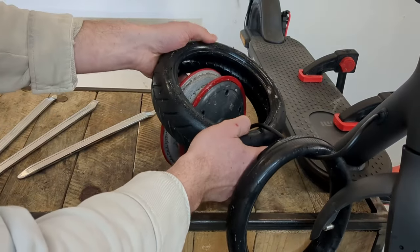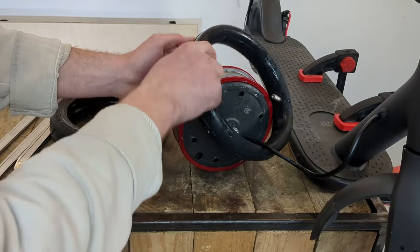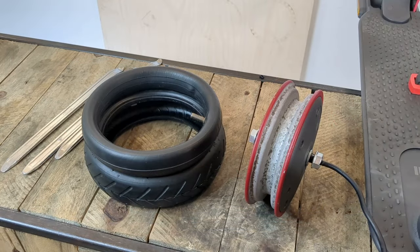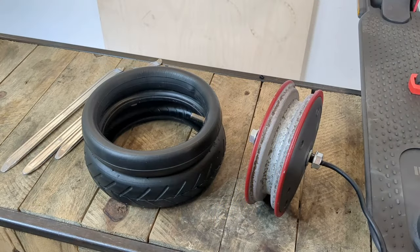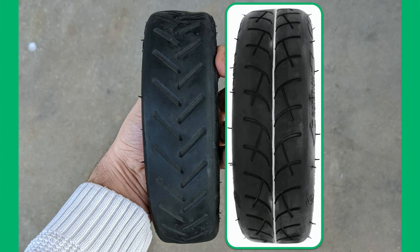We pass the tyre and inner tube around the motor of our Xiaomi. Now you're able to see if you need to change only the inner tube, or the tyre and the inner tube. There are two points to check. Number one: look inside your tyre, and if you see filaments or rubber deposits, it's time to change it for a new tyre. Number two: look at the outside of your tyre, and if you see that a tread is much too worn and at the end of its life, it's probably a good idea to replace it with a new tyre.